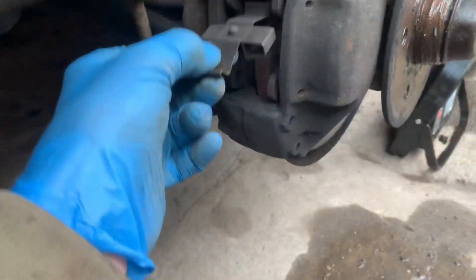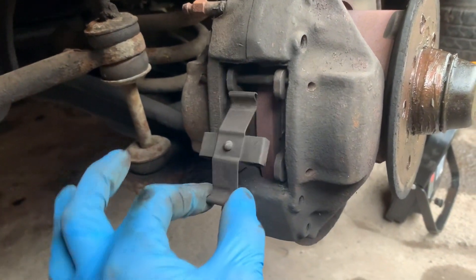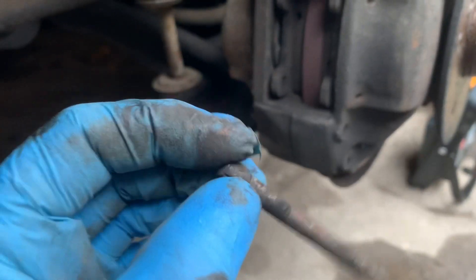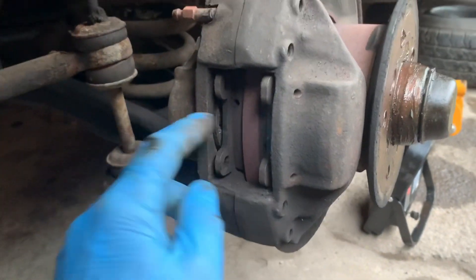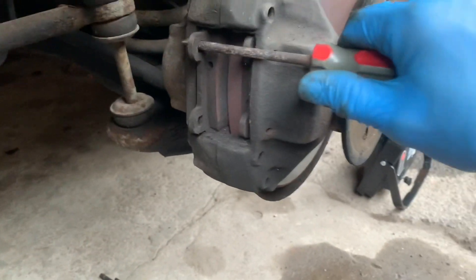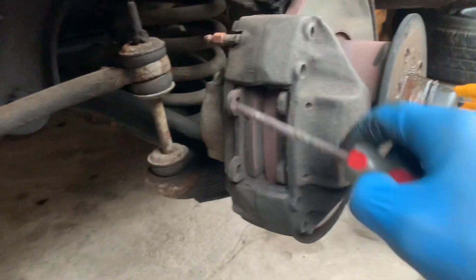The car hasn't been used for a long time. It's not unusual for the brake pads or calipers to stick. We're just going to whiz this wheel off and have a quick look to see if it's something simple, because this car is going to be used in a film in the next few days. We need to make sure it actually works. We're just going to knock out the brake pad pins — this clip here is holding them in. Then we should be able to pull out these pads, though everything's so hot. You can sometimes wedge them out carefully with a screwdriver.